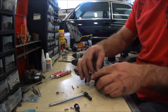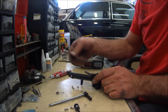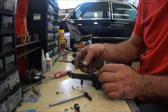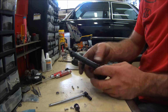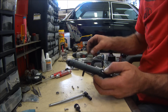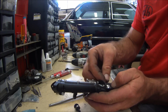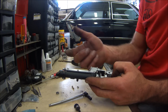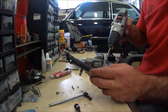Because if you take a shaft and it just slides in there, and you think, wow, that fits really good. Well, what happens when you're going to drive on it is it's going to wear. Everything wears out. And so now that thing that you'd consider a perfect fit is now sloppy. So what's going to happen here is you're going to have this too tight a fit, one that you got to hammer in, and it's going to wear. Like I just said, everything does. It's going to wear, and it's actually going to become a perfect fit. I mean, you'll probably be able to drive on it for, you know, so many battery packs, and then you'll be able to take it and slide it in with a perfect fit.